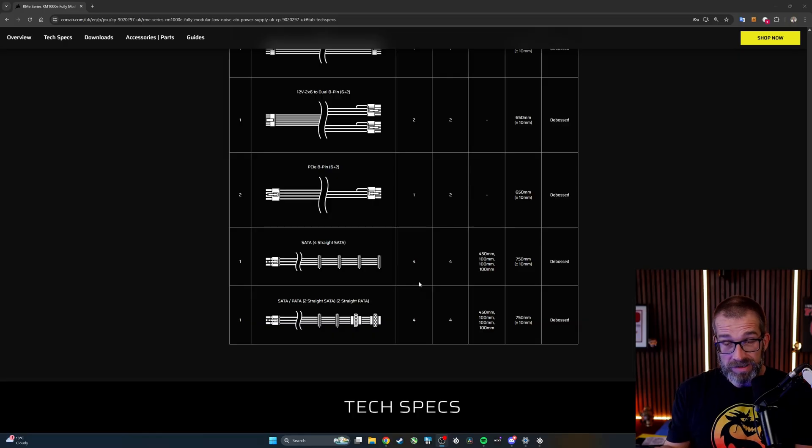It's worth checking before you commit to all your parts that the power supply has all the connectors you need. Sometimes it's as simple as buying a higher wattage unit. Corsair also has a PSU calculator to help with wattage recommendations. But it's not always just about power — in this case, it's the complexity of the connectors. There might be enough wattage but just one missing PCIe power connector depending on the GPU, especially when considering AMD versus NVIDIA.